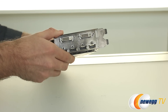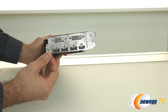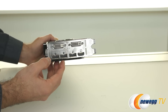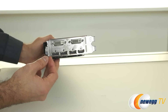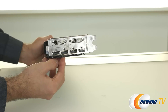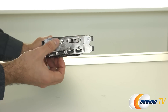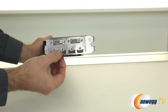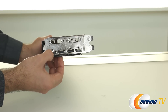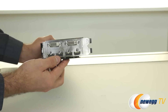Spinning to the front, the outputs use Gigabyte's Flex Display technology — which automatically selects the active outputs up to a total of four. There are six outputs total. Notably, there are two DisplayPorts and one DVI-D (digital only) output: you can use the two DisplayPorts, or one DisplayPort will disable the DVI connector, or using the DVI connector will disable the two DisplayPorts. Separately, one DisplayPort output, the HDMI output, and the DVI-I output will all three work regardless.